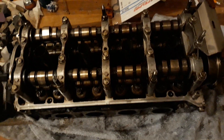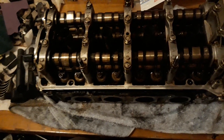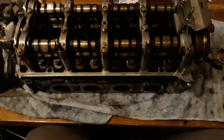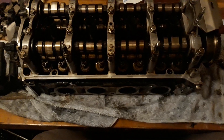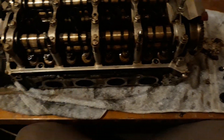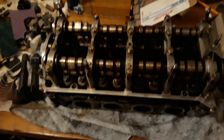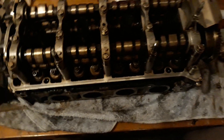It's been a really long day. I didn't get the car work done that I wanted because it was raining on and off all weekend. In the process, I got the Z3 head off, put it on the stand, and used my breaker bar this time to break off the head bolts. This is advertised as a blown head gasket, but when I took the head off and inspected the gasket, it didn't look breached. There was definitely water mixed in the oil. I noticed two of the head bolts were kind of loose, so I'm thinking it wasn't a blown head gasket — somebody had probably been messing with it before. The head gasket looked relatively new.